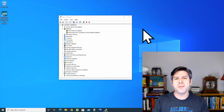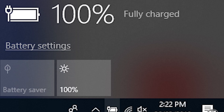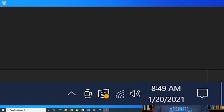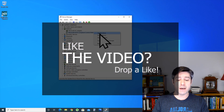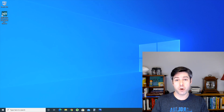To show how the laptop could run without a battery: down in the taskbar you can see the battery icon showing it's available, plugged in, and currently charging. If I right-click the Microsoft ACPI Compliant Control Battery and disable the device, you'll see that the battery icon disappears from the taskbar. Windows 10 no longer recognizes that there's a battery installed and is purely using the Microsoft AC adapter for power. I can go back and enable it again, and once it refreshes the battery icon comes back and it's now charging again.